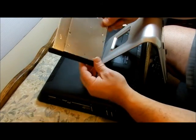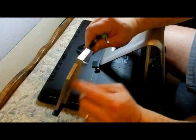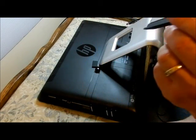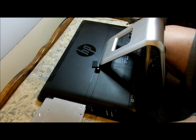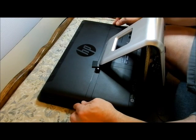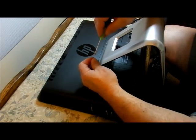So if you have to replace your CD drive, that's how you do it. There's some dust in there — I'm going to brush that off. Dust all around this, so I'm going to blow that off. I'm going to pop it back in, kind of jiggle it around and work it in. You'll see it down there — push it all the way in. Don't overdo it because you can push it in further than needed. We're going to put the screw back in. I learned in the Navy to keep your finger on the screw at all times — it stops it from falling.